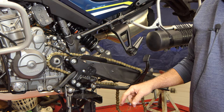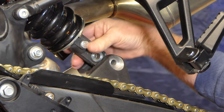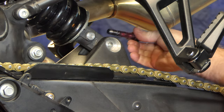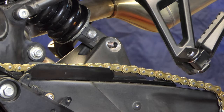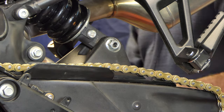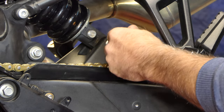I didn't really like the looks of these bearings and the sleeves are starting to show some wear — I may go ahead and order new bearings and sleeves and replace them in this swing arm. For now we'll put it back together while I wait for parts. Back here on the rear shock I need to go ahead and put it back on the swing arm. The bolt runs through from the back side on this bike. I'll tighten this up — I have to hold the bolt from the other side with an allen key. This is an 18mm and it torques to 60 foot-pounds — there it is.